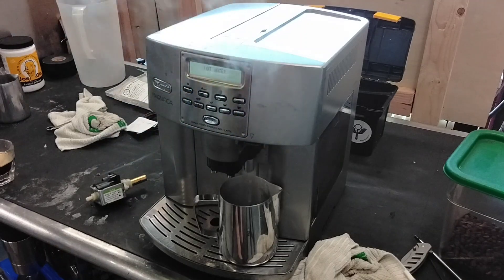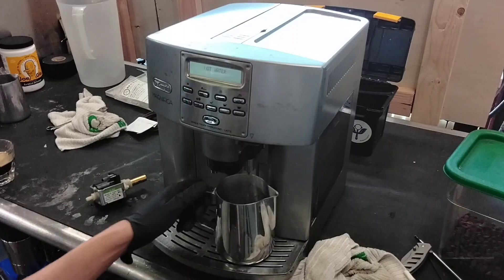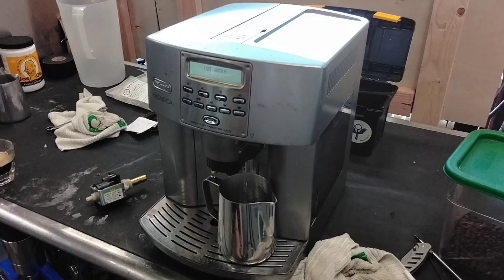The steam and hot water side are functions that use the same generator. So after years of storage, there's likely a little bit of scale buildup. Hopefully, descaling at home is pretty simple and will fix that up — it's just a fairly long process. We didn't do much cleaning through this machine, but it's still a solid delivery and it works pretty well. After running it for a while it did clear up compared to when I first started — it was very spotty and not a lot of water was coming out.